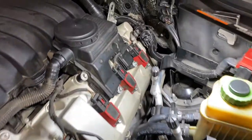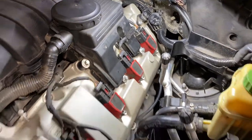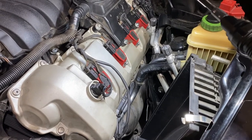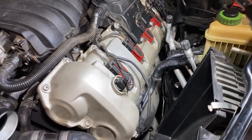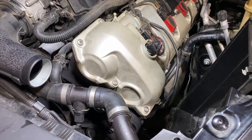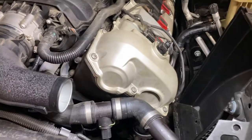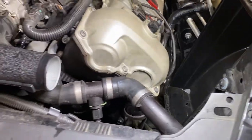There's a lot of discovery that I was talking about here. You've got to take out that plastic housing. And when I tried to put this back, the gasket for the spark plug kept falling off. So I had to struggle a little bit to put it back. After that, learning from earlier, I gingerly torque each bolt so I don't break it. Working with this kind of aluminum engine, you just got to be super, super careful.